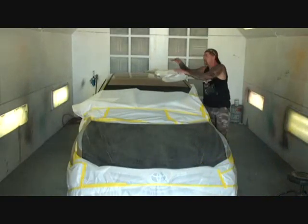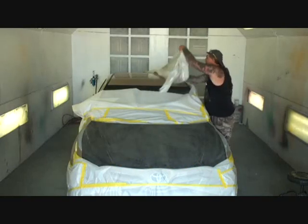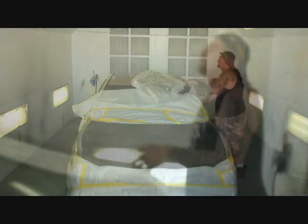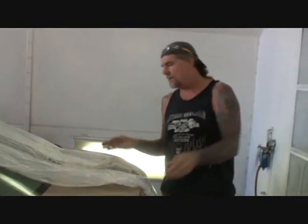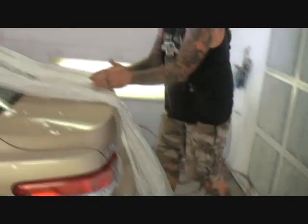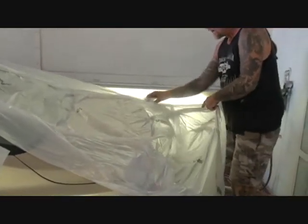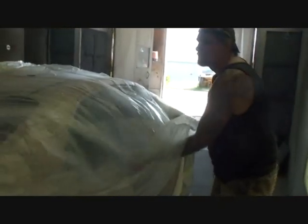Take your plastic and set it right in the middle — let's say we pulled it from the back and brought it up here. You want to put it with the paint side up, so flip it if needed, and stick it right in the center. Notice it's stuck to the car as I'm pulling it — that's the static doing its job. We get it centered and then start pulling it apart because this plastic is designed to be a one-man job. Even in semi-windy conditions like right now, the plastic sticks to the vehicle.